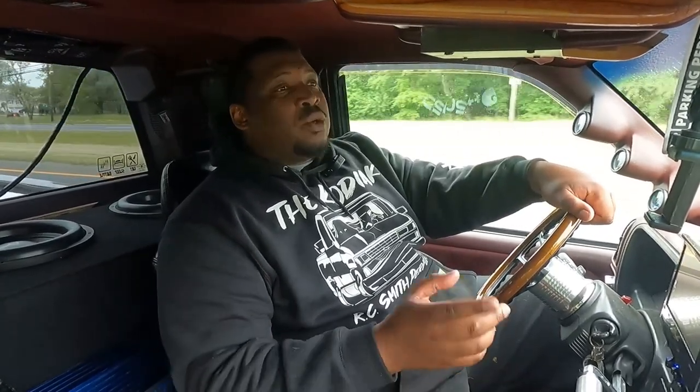And like I said, this is gonna get me a long way because I don't think I'm gonna max out my critical speed until about 6,000 RPM. After doing the math, that gets me to about 125 miles an hour. And that's with the 390 gear ratio, the 28 inch tall tire, and the 4L60E transmission. So if I make the tires bigger or taller, then I can go even faster. So yeah, it all worked out. This pretty much buttons everything up.